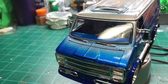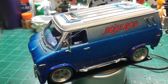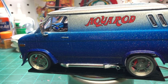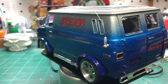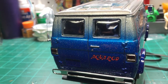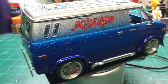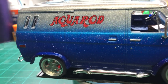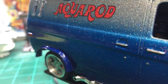The paint on this is House of Colors candy urethanes. I laid down an Orion silver base coat, then along the bottom the darkest edge is faded in with candy purple base coat — which is a blue-purple — then I used candy oriental blue over top of that, fading up across midway through the van and into the silver. The whole thing was top-coated with House of Colors cosmic clear, and I used my trademark holographic flake in there, which you can see changing color as the van rotates.